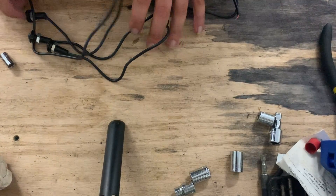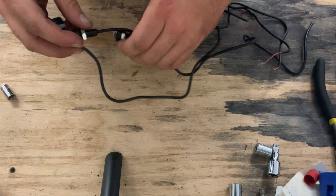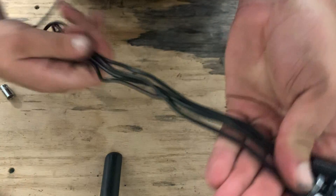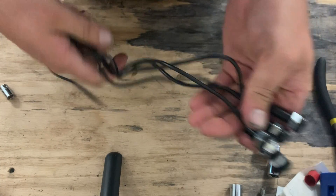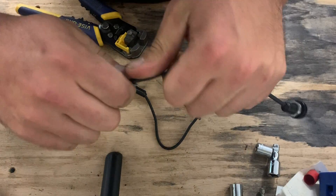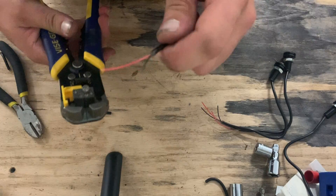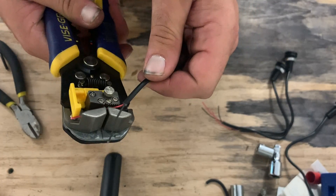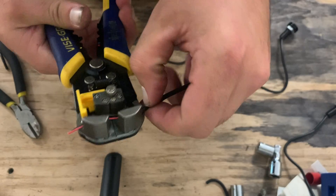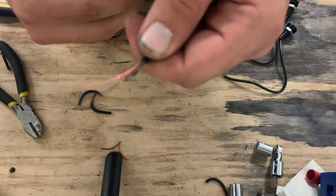What I'm going to do is take all four of these lights, get rid of all this mess, and combine all of them into one positive and one negative. I'm pulling off each connector — positive and negative for each of them — then snipping the ends. I bet I can do these at the same time. Take them all off so you just have the wires.